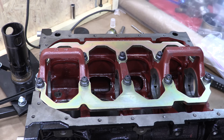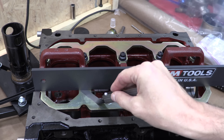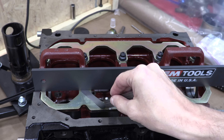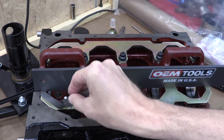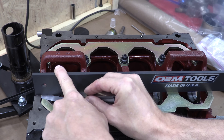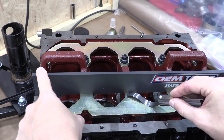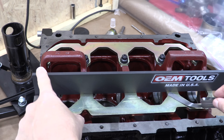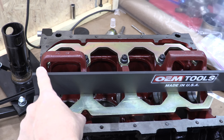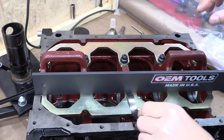The fastest, laziest, and generally worst way to check the mains for straightness is with the straight edge and feeler gauges. Lay the straight edge down across the mains and see if you can fit the smallest feeler gauge under it. You can do this with or without a bearing girdle — in my case I do have a bearing girdle. This will quickly reveal whether your main caps are straight or whether the block ever had work done to it before. Quick and dirty tests are the best kinds to always do first. Non-invasive tests like this, or like the PlastiGage example, can save you a whole lot of time. And just like with PlastiGage, if you want to actually pinpoint a problem, you've got a whole lot more measuring to do — but at least you know where to start.